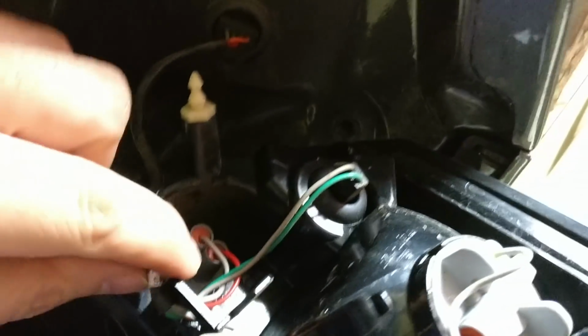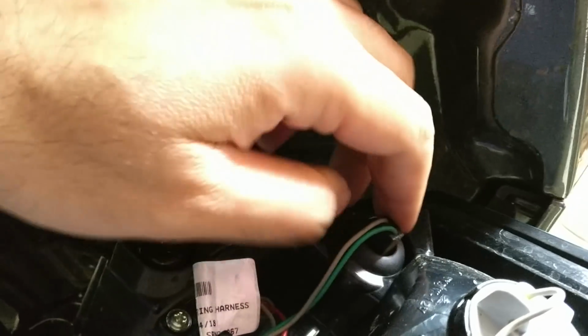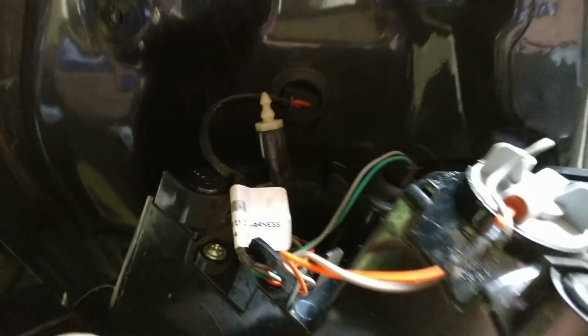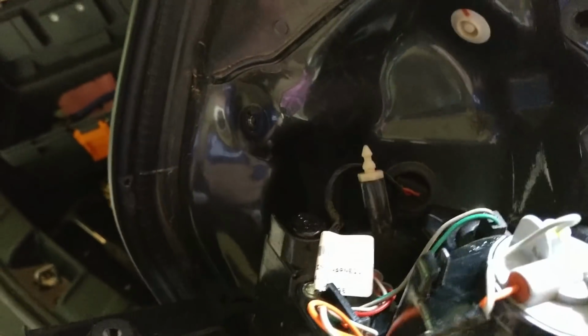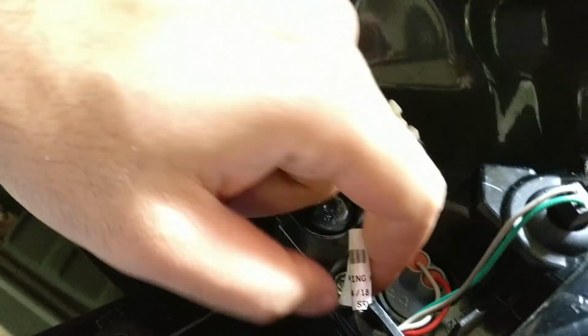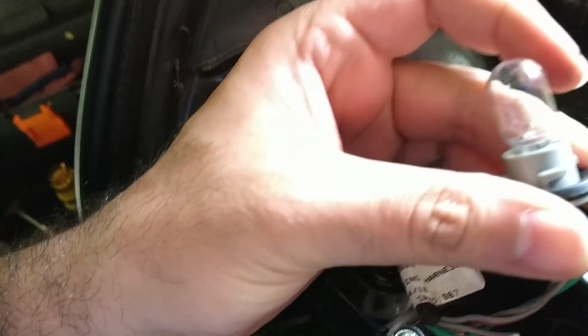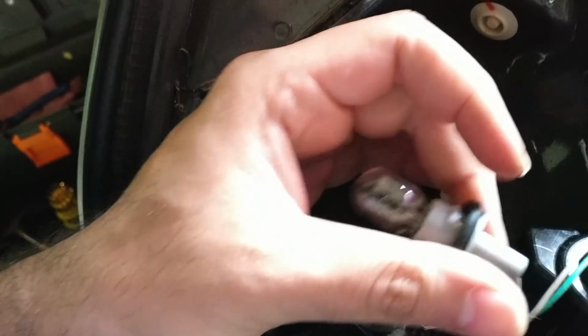So let's take a look at the bulbs which it has. Okay, so that is the DRL section at the bottom. Then you have the reverse lights. I think that is the brake light. Yeah, the one at the bottom is the brake light. The biggest ones here are actually the turn indicators, and that's the 21 watt bulb. DRLs are difficult to replace in this. I think if something happens to this, you'll have to just change the tail lamp section, so just be careful with these.